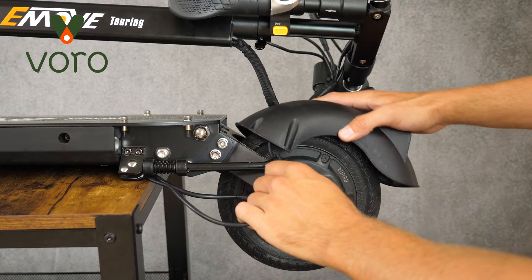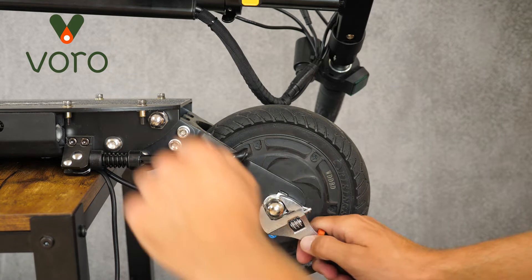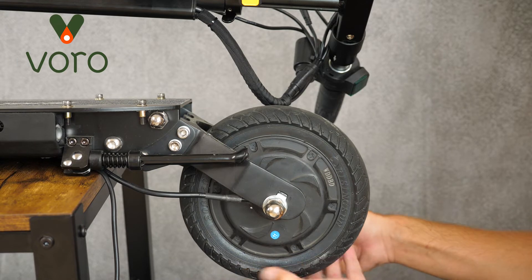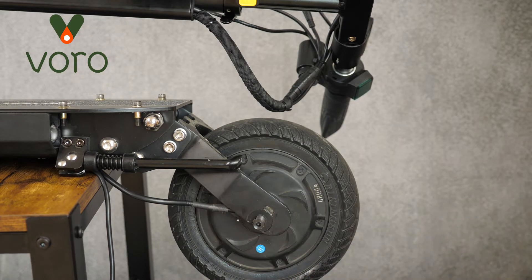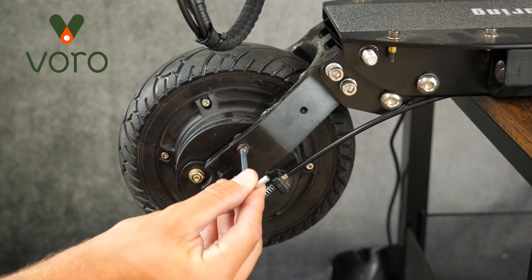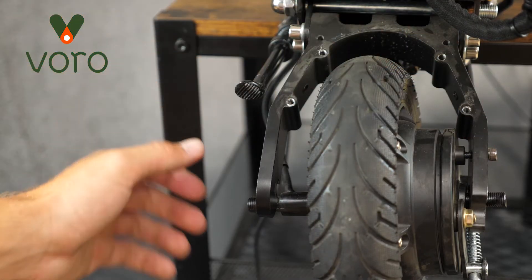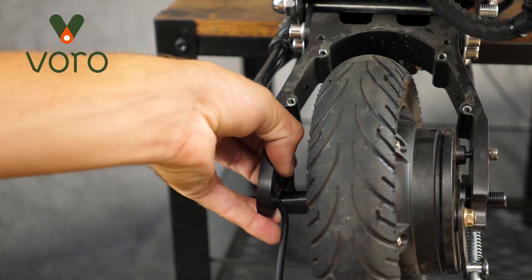Looking at the back of the scooter, I realized I made a mistake — ideally you want to run the fender wire right in front of the wheel. This is an easy fix though: all we have to do is remove the rear wheel. Start with a wrench and loosen up the wheel nuts — there's one on each side. Then use a pair of pliers to pull out the washer on each side. On the other side of the scooter, turn this bit counterclockwise to loosen up the brakes a little bit. Then with an Allen wrench, go ahead and loosen up this last screw. Make sure you support the wheel with your hand underneath it — you don't need to completely remove this screw, just loosen it. You'll have enough room to slide the fender wire on top of the axle and in front of the tire.